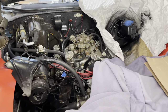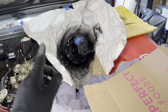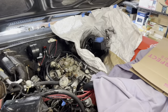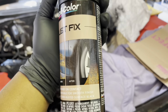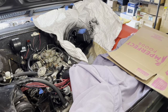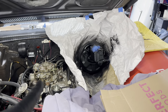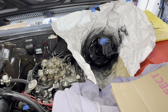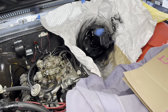It is a few days later and I am out here attacking the car. A number of different things are going on here. Finally getting able to paint that booster — look how much better that thing looks already. I sprayed my rust neutralizer on it, which sprays on clear. This is before rust and that would be after rust — it actually turns it black, which is pretty dope. You can almost consider it a primer, but they suggest you can put a top coat directly or go primer first. I just sprayed a brake caliper enamel since it's going to be near brake fluid, just so the paint doesn't run or stain if it leaks at the bottom.